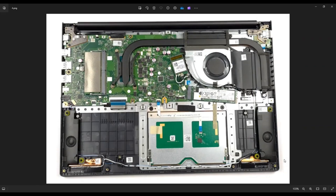Now that your battery has been removed or at least unplugged, it's safe to proceed deeper into the computer. This is your solid state drive right here — you have a single M.2 port at a slight angle underneath your fan, and it screws into the case. You would undo that single screw, free up the solid state drive, and pull it out of the M.2 port. Gen 3 or Gen 4 solid state drives are supported in this computer, and stock most of you will have a one terabyte drive. I'll have one terabyte and two terabyte upgrade options for both Gen 3 and Gen 4 in the description link. When you install a new solid state drive, you'll need to install an operating system — I'll have links below showing how to install Windows 10 and Windows 11.